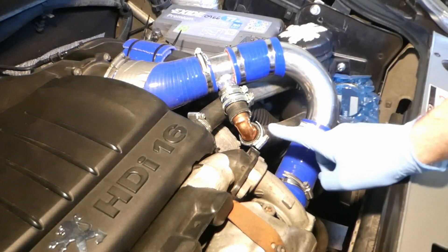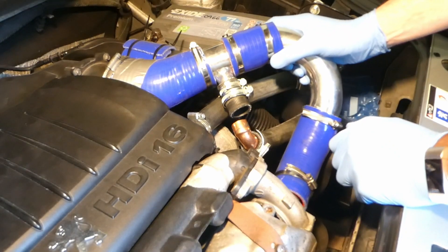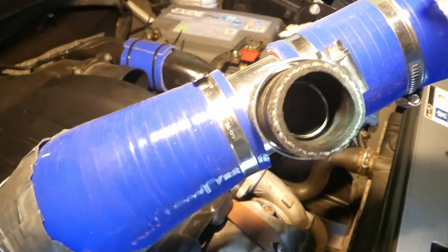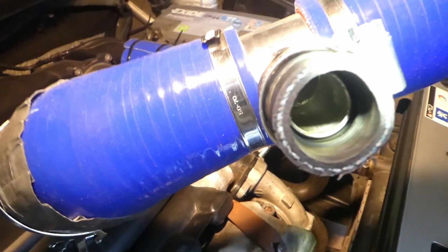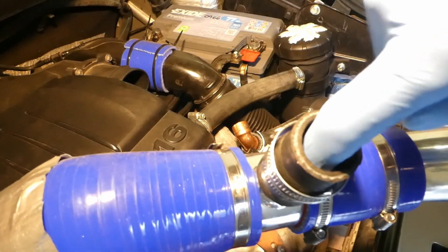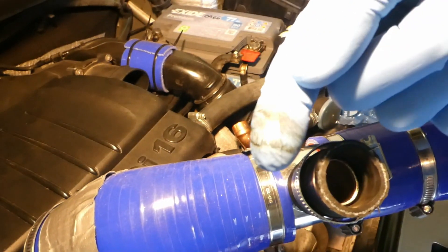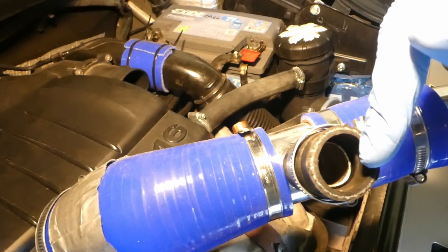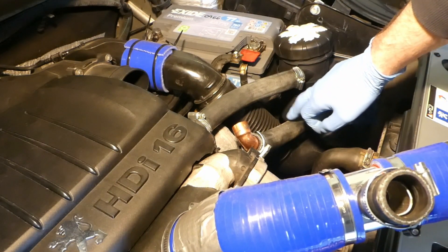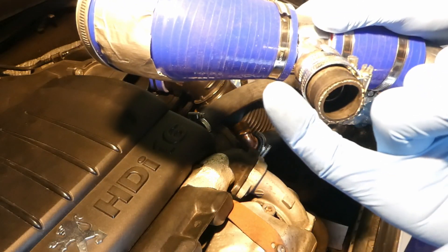I've slackened the tubes to see what's the condition. Just a quick check from the breather — you cannot quite see there but if I put my finger in, there is quite a bit of oil. You can see there is a bit of oil. So in other words, oil vapors travel from the engine up past the oil catch can. The catch can doesn't really quite condense the oil vapor. My finger becomes slightly on the darker side — it does let quite a few oily bits through.